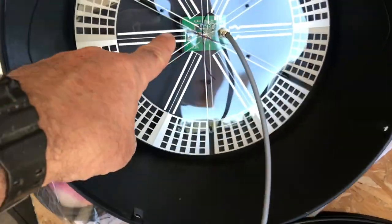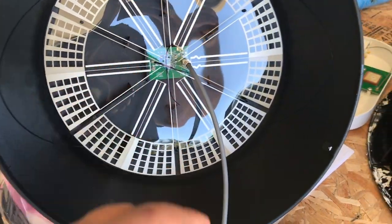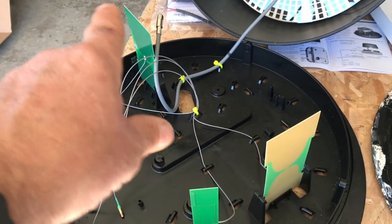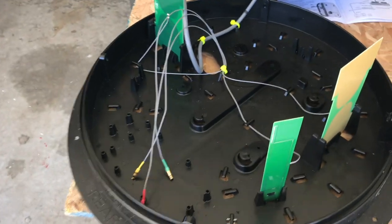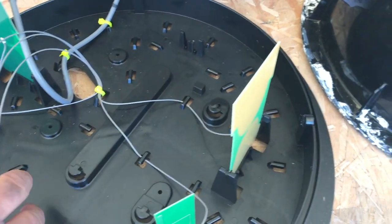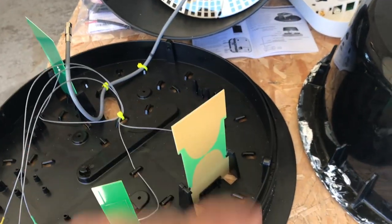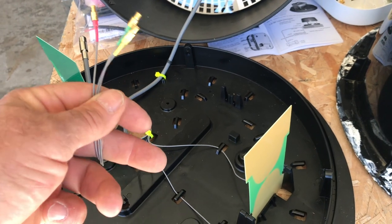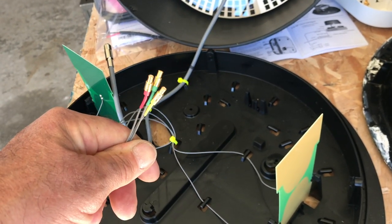The Air 360 Plus, which is what you need to make the router work, has the same UHF/VHF TV antenna connected by a wire down into your rig, but it also has two cell phone antennas and a Wi-Fi antenna built in. There's a space where you mount the Winegard Gateway 1000, and the missing component between them is these Wi-Fi and cell phone antenna cables — without those, it doesn't do a thing.